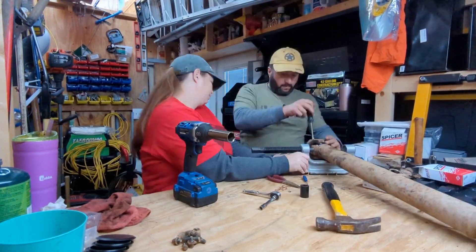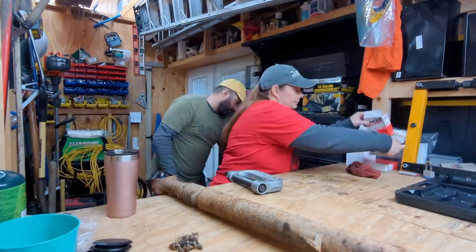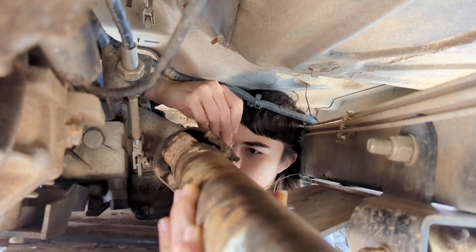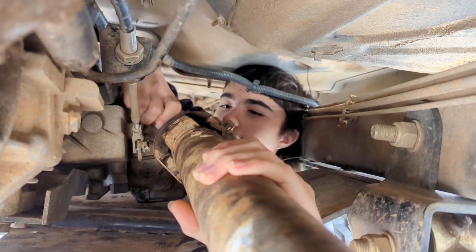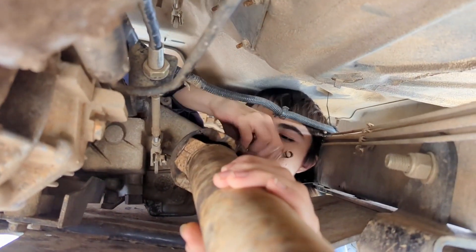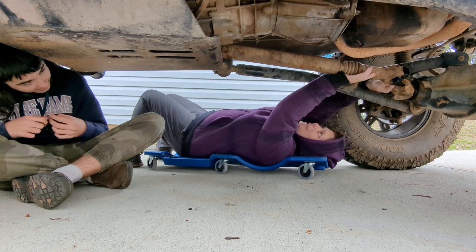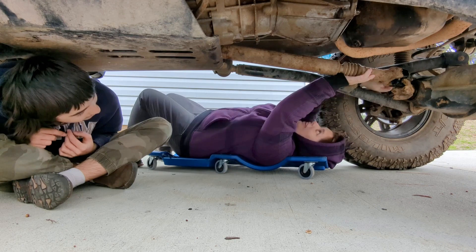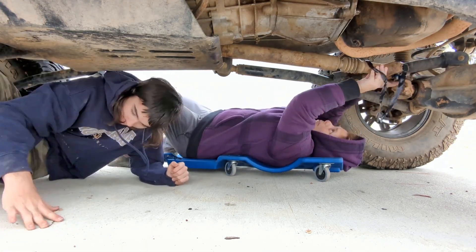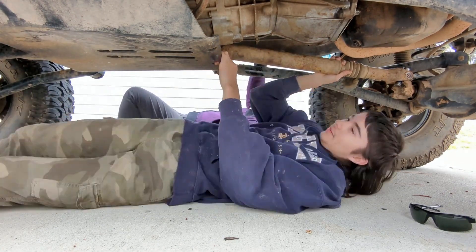Put the three new joints in — two on one side, one on the other. The new cardan joint, line everything up, make sure the grease fittings are where they're supposed to be. There's little indentations, and you'll figure it out. That new seal around the cardan joint — I don't care if I'm saying it right. Slam this thing back in, take it for a road test. Squeaking gone. Another successful fix until she runs it through the first freaking mud puddle again. Anyway, that's why we have tools, right guys? Thanks for checking us out. This was our angry sparrows chirping — that's what everybody's calling it — or how to replace a double cardan joint, which I'm probably not saying right anyway. Thanks for watching everybody. Go anywhere, do anything. We'll see you next time.